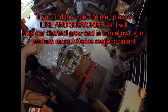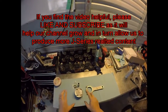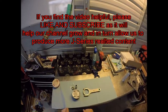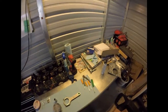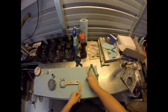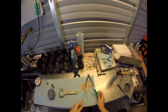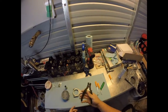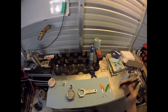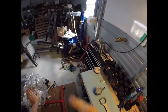The engine is going in this build right here — got most of the front covers on, water pump, oil pump, everything. I have the rings gapped already. Today I'm going to show you a quick video of how to mate the rotating assembly together. To get started you need the proper tools: we use picks in different styles — a 90-degree, a straight, and a crooked hooking one — plus a flathead and a piston ring tool.